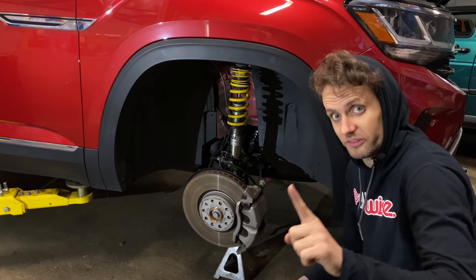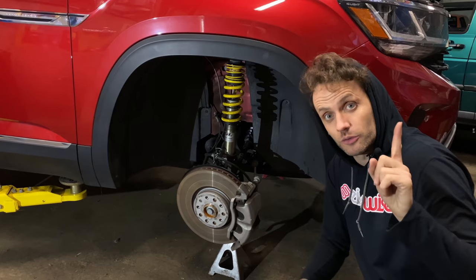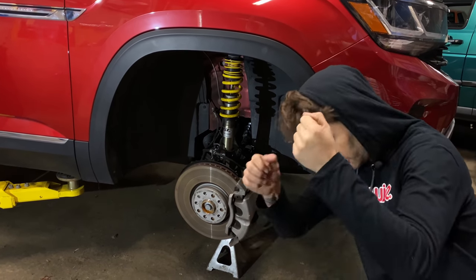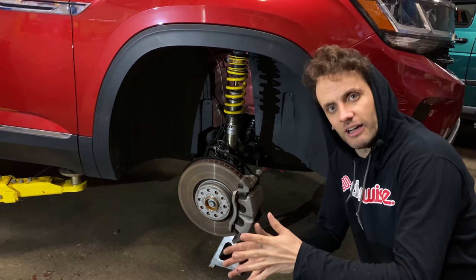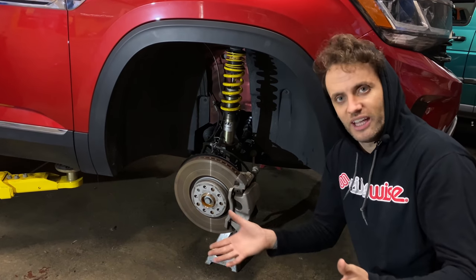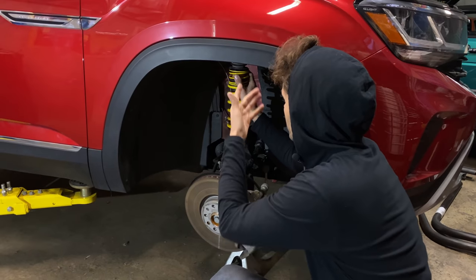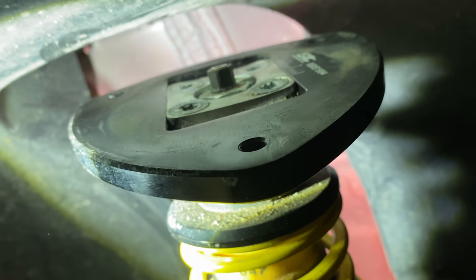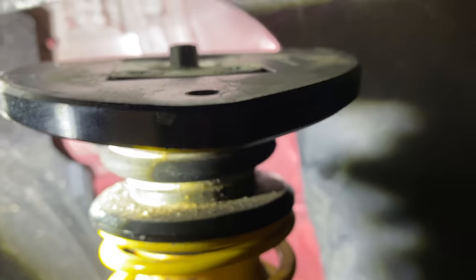Here's a top tip: when your suspension arrives, it's going to be laying flat on its side, so you have to prime it. Take your strut and just push it up and down about five times to get all the oil in the correct place before you mount it — otherwise it's going to ride like crap until it settles itself. We don't have the original strut mount; it does have the camber adjusting plate up top. We're going to put that in with stock camber for right now, and we might have to change that a little bit later.